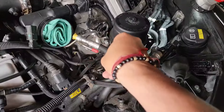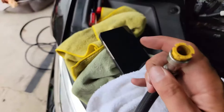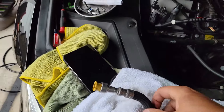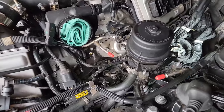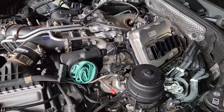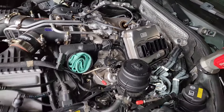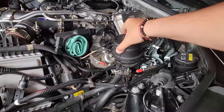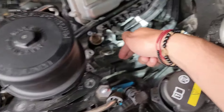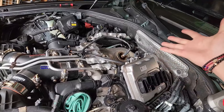There was a fuel line preventing things from moving. Basically, you press in and pull out — that's how it locks into place. This side is harder because there's less room. I'm going to slowly start taking things apart. The power steering reservoir needs to move a little out of the way, and some of these lines need to move so we can get to the bolts that hold the wiring loom that goes to the main computer. The computer stays more or less in this area.